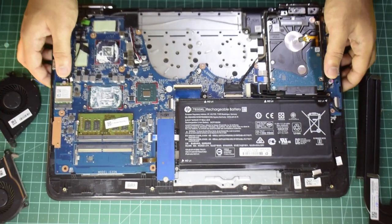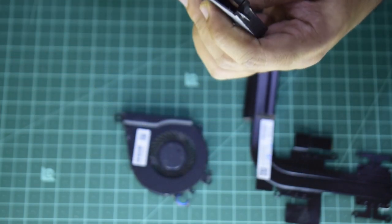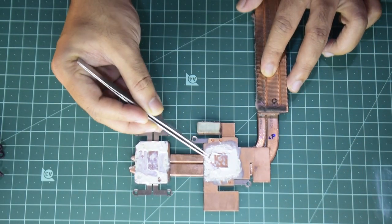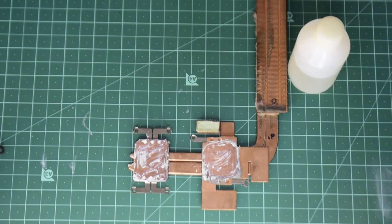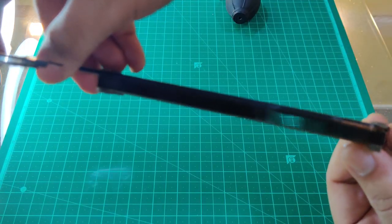For the time being I'm going to set the laptop aside and clean the rest of the cooling system first. Laptop fans are relatively open and easier to clean — just use a brush and a blower to remove any dust or dirt that may have settled onto the blades. With the fans done, it's time to clean the copper heat pipes. The existing thermal paste is pretty dried up; I'll have to use a pair of forceps to pry it off. To remove the rest of the residue, take some isopropyl alcohol on a cloth and rub it on the copper plates until totally clean. While you're at it, dust off the grill as you need it unblocked when the hot air passes through.